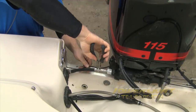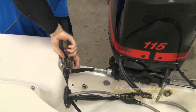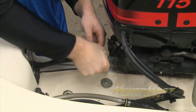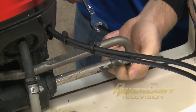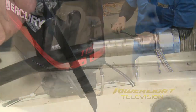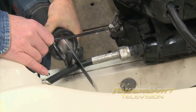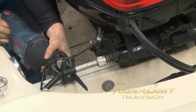Before I could do anything, I had to remove the old mechanical system from the Grew, so I got to work. I started first by disconnecting the mechanical cable from the outboard. After that, I removed the linking arm. Since we didn't need to save any of the parts, I used our Bosch Sawzall and a heavy-duty metal blade to get through the aircraft cable-filled mechanical cable.